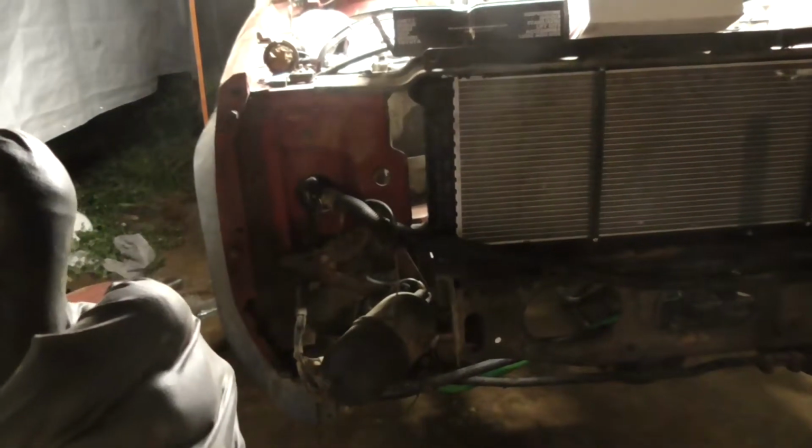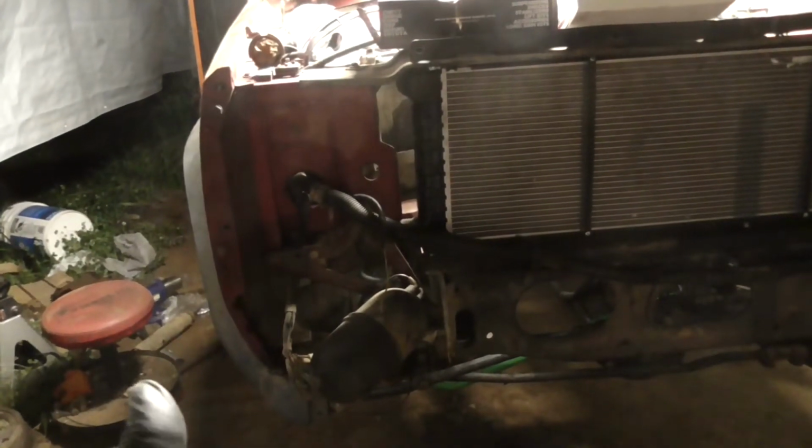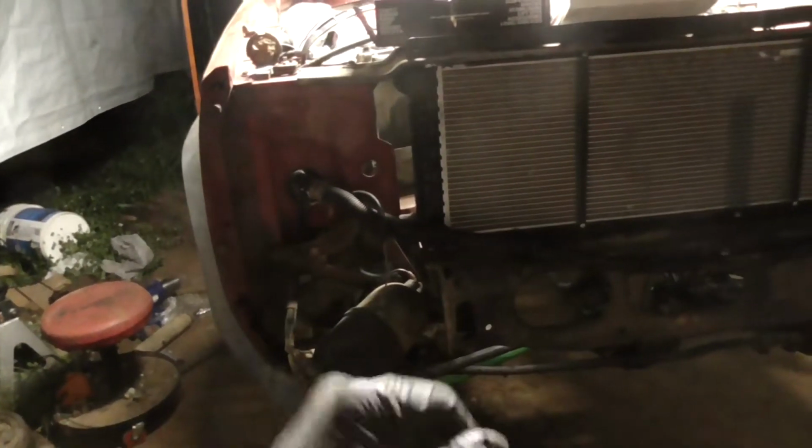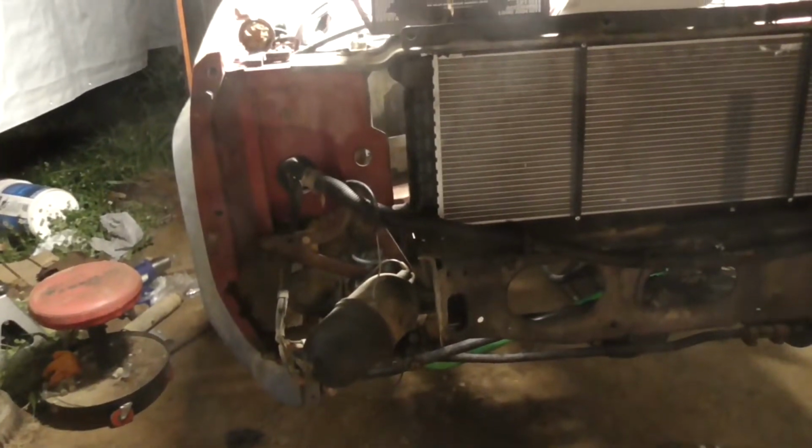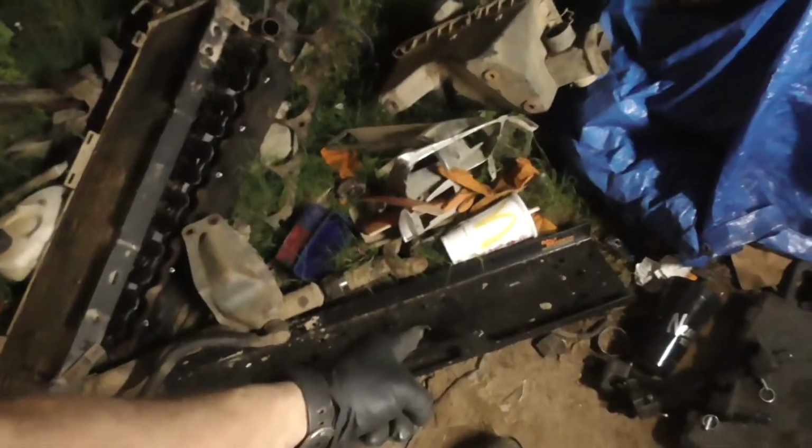What I have left to do, like I said, I got to button up the front, tighten all that stuff down, put the extended brake lines on in the front. In the rear, I'd need to put them on too, but I might just kink down that line again. It's already kinked down once, but I'm honestly probably going to put them on. Bleed the brakes after that. I need to put those TJ to XJ RS5 bumper brackets on. I need to bolt my Mile Marker winch plate to that, then bolt my winch to that. Put my military terminals on.